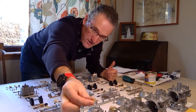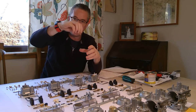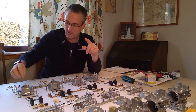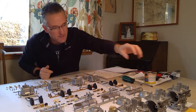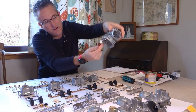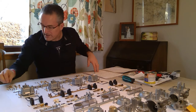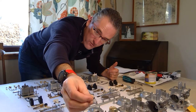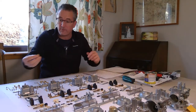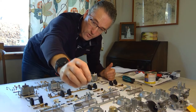The little mixture screw for setting idle mixture has a spring, then a tiny washer, then an O-ring - be really careful when taking it out that they don't fall away or get lost inside the carbs. When putting it back in, I found it easiest with the carbs upside down to get the spring, washer and O-ring set up and push it in from below, rather than dropping it in from the top where everything falls off. The float needle is another common problem - the little rubber tip can be damaged, so take a close-up photo and check it carefully. The needle also seats into a seat, and sometimes the O-ring there leaks - watch for fuel getting past.